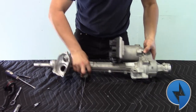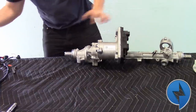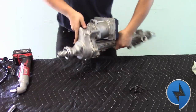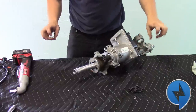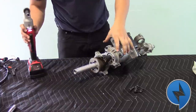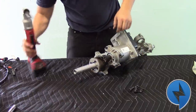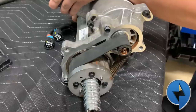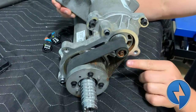We're going to remove this case on the right to give you a good view of the belt that's inside and the motor input shaft. There are five 13mm bolts. This cover will come right off and then you can see the belt that actually drives the autonomous vehicle. One cool thing about this is the way the motor is mounted — it's actually eccentrically mounted. So when you tighten these three bolts that hold it on, you can rotate it, and it actually tightens the belt. We're going to loosen these bolts — not quite take them out. You can see the belt's very loose now. When they manufacture and assemble it, they rotate this to the point where the belt is tight enough. That's very interesting.